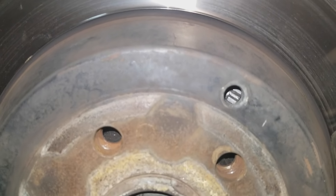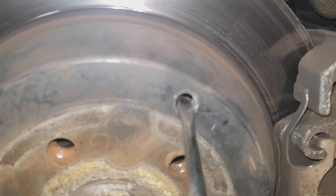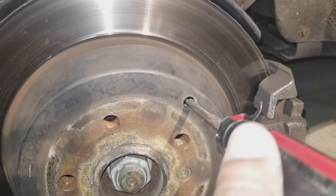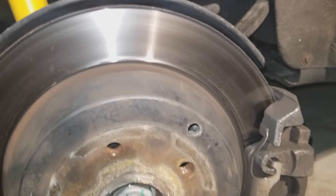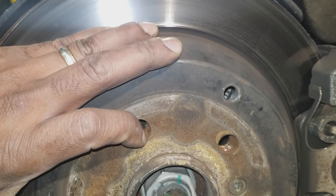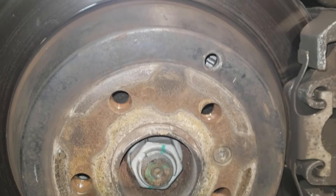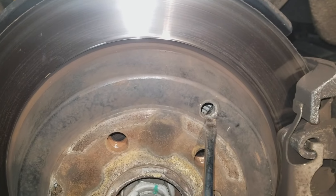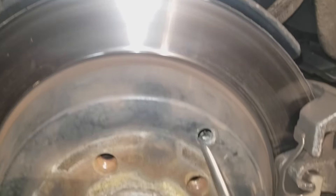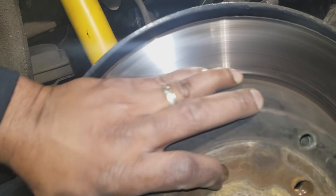What you're going to do is put your screwdriver inside and just turn it, pushing those teeth up and down to the point where the rotor barely moves because the brake shoes are making contact. Once it's set to that point — where it's barely turnable — go in and bring it down a notch so that it's turning freely again.